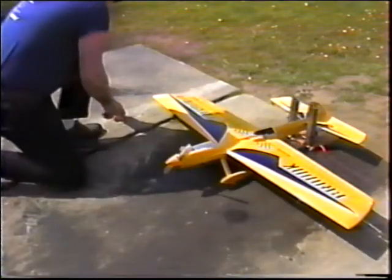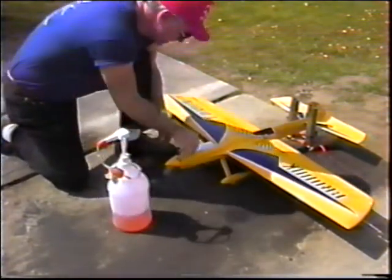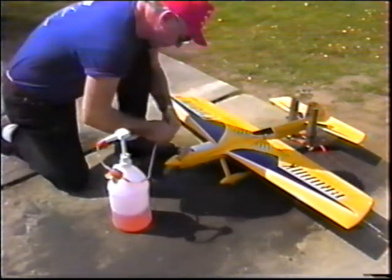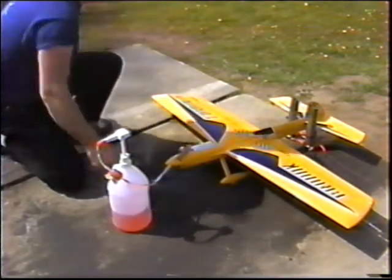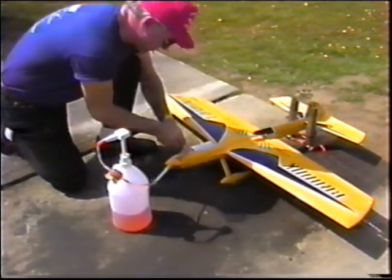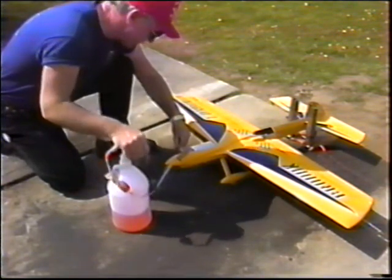Good, it's warming up now. I try never to do my testing early in the morning when it's cool, because you always get these amazingly good readings. Motors make more power in the cool weather. You get these incredibly good horsepower readings. I like to wait, and it's getting up in the temperature range now. So I think we'll have a valid test here before we do this muffler test. Again, we don't have the one from Randy Holcroft yet. That'll be an interesting one to test.